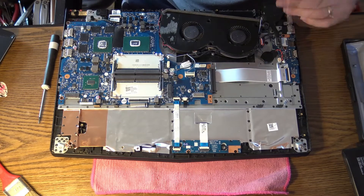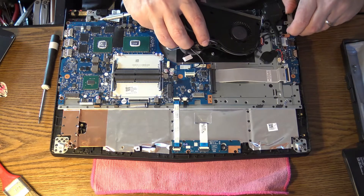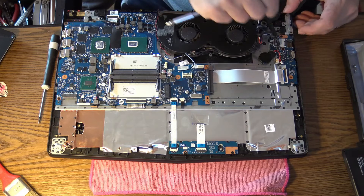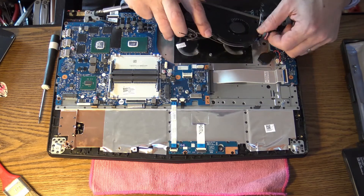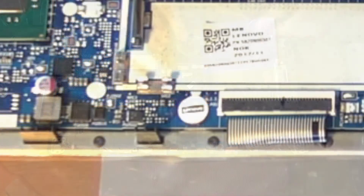The fans are out and now we can give all our attention to the motherboard. I've never dismantled this one before. Over there on the left — let me zoom in a little — you can see that round label with the Lenovo name on it. That's a seal on one of the screws. Don't forget to take that off; you can't remove the motherboard without it.